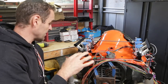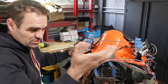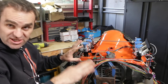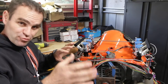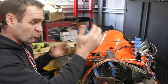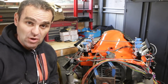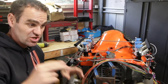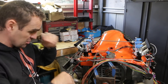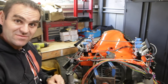I've started laying out the loom and discovered it's quite sensibly laid out — all the blue wires with different coloured traces are the ignition wires, and all the brown wires are the injector wires, so I can just lay them out pretty simply. They're separated out by injector one, two, three and so on — one through six for the cylinders for both injector and ignition. The ignition wires I will have to splice into because I need to split that signal so it fires both coils at the same time. I'll split them at the same point as where the power is split on the loom so everything flows together.